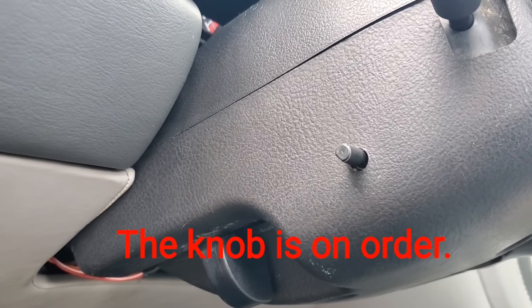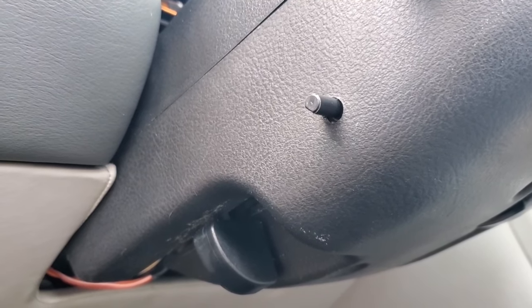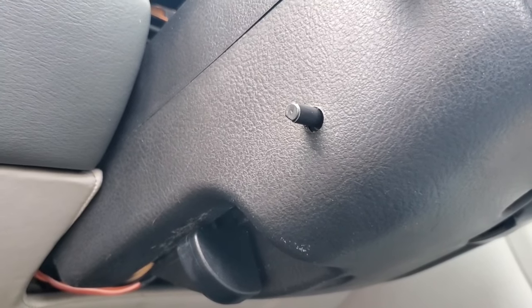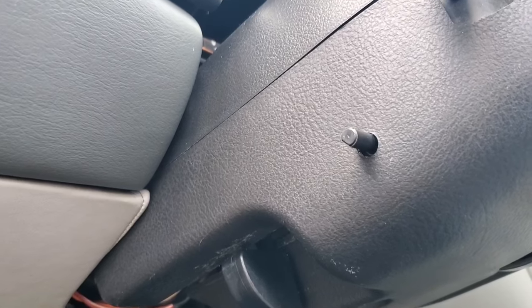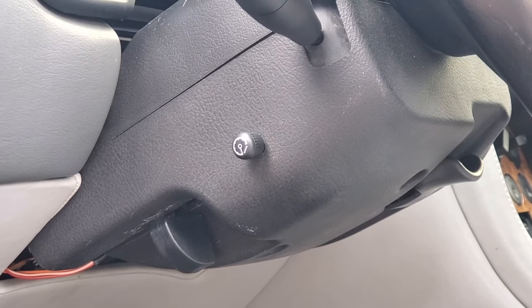lights. By removing just two screws, which are in this area down on the bottom, I could remove that whole piece, get to the potentiometer, take it out, take it over to the workbench, and work it several times and use the multimeter, and it's 100% working again. Beautiful gauges at night. I'll show you that in an upcoming portion of the video. Here you can see the replacement knob we got from Aston Martin.